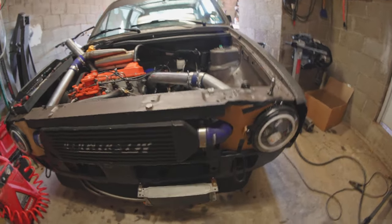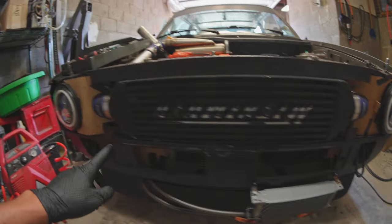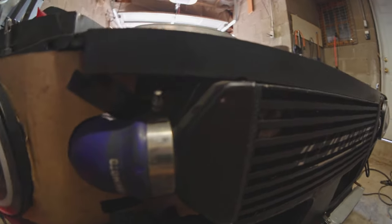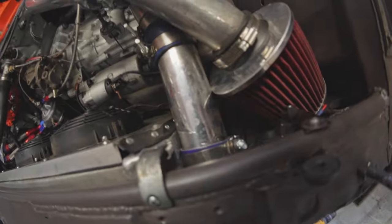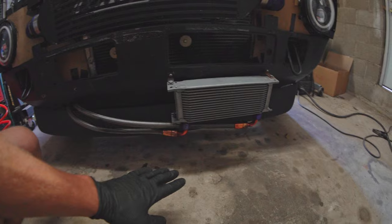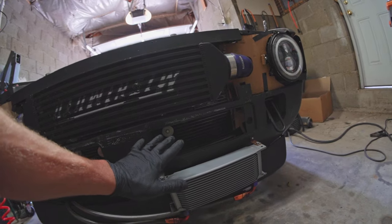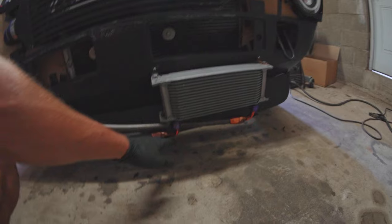In other news, I've also been working on the overheating problem. This is my V1 front valance cover — it covers the headlight area and funnels air behind the intercooler and in front of the radiator so we're not losing any air. I also moved my oil cooler down. I don't really expect it to do much down there, but it's now kind of tucked out of the way — although it's now at speed bump height, which is a little scary.